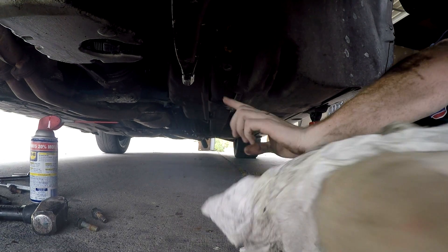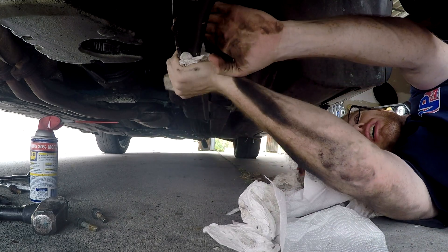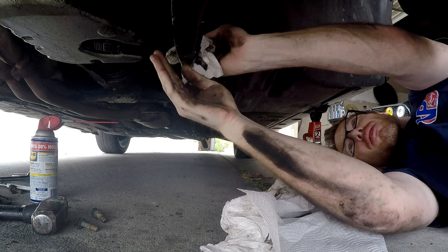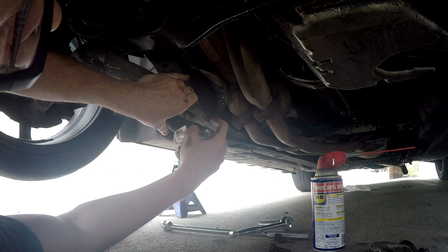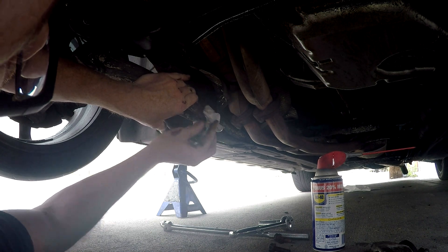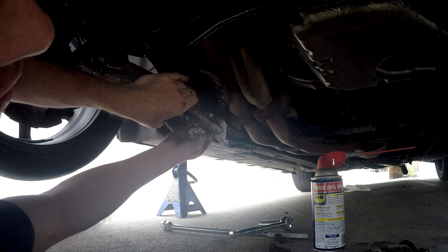Okay so we have the end of our control arm fully exposed. I need to clean some of the filth off of it and get it ready to assemble the new control arm bushing and housing on here. There is a definitive stop on the control arm right here where it bumps up in diameter — basically the bushing will bottom out on that point and that's when you know it's fully installed.